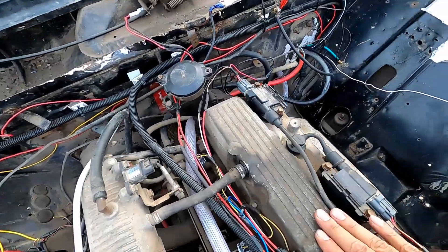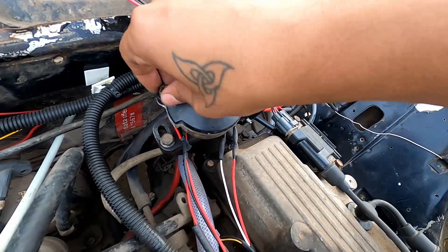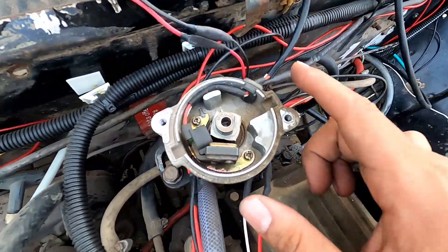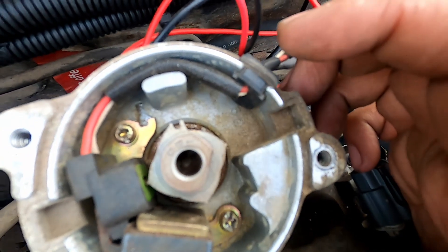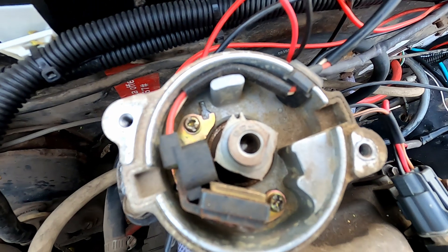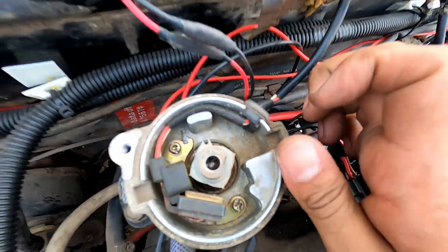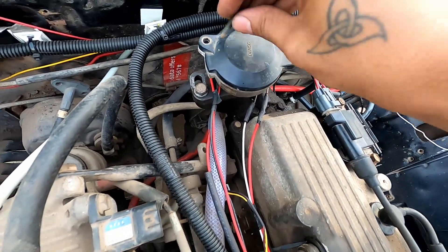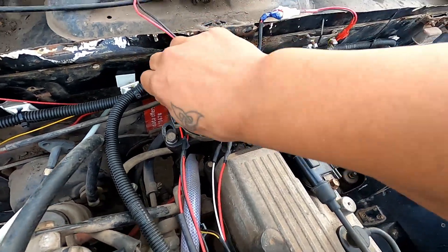The critical part was this — this is our trigger. In our engine, this is the kind of trigger known as a plus-one. It means one cylinder tooth is more than the others — you can see there is one, two, three, four, and the fifth one. This trigger works with our ECU in TunerStudio, so setting it up was easy.